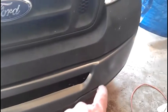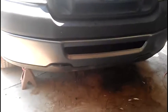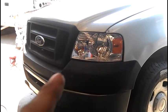There's the truck — we got it all put together. We ended up using the original rubber on the top and the bottom; it still needs to get its memory back because it was pretty bent. But as you can see, the gaps look good, the hood looks good, it lines up good. It's ready to go. I already charged the air conditioner on it, put some antifreeze in it. We're going to pull it out of here. That's the one I replaced the radiator support on — you can see that rubber still has a little crease in it.